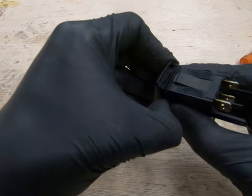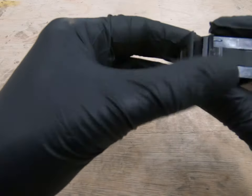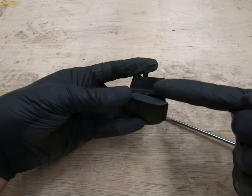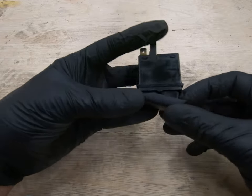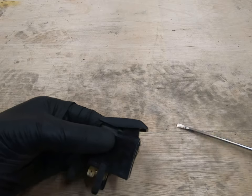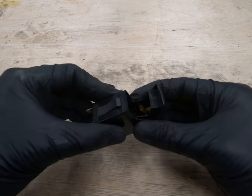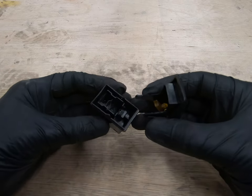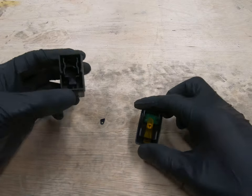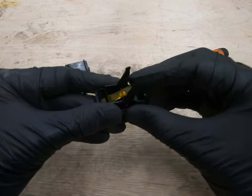There's a bit of a lock in here — this is going to come off. I think I need to lever the outside of this case — yeah, there we go. I'm putting some force levering the case outwards. I think there are some pegs in the case that fit into holes, just in this rocker switch. So I've done that side, I'll do the same here. There we go — that should lift out. Don't go exploding. And we have a broken tab. This tab here looks to have broken off.